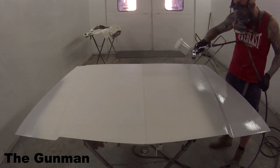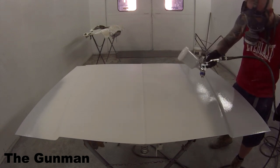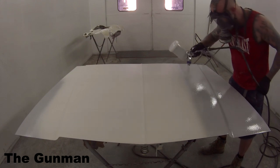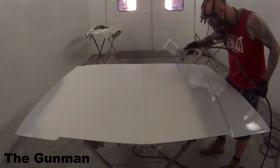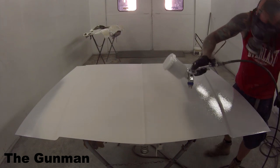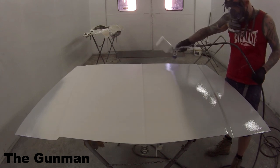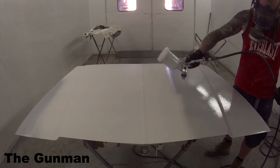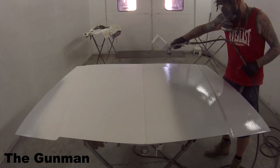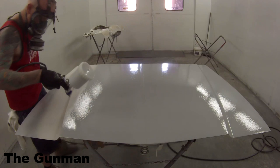The hood's actually still not finished — I'm just editing this footage up as I go. Unfortunately I can't give you guys an ending on this car yet. Usually I like to include the finished product at the end of each video, but for this one I'll have to leave it as is. Back to the gun itself — great gun for the price, totally an absolute winner. I think these Star guns are starting to get a little bit better. I've got a little Star mini gun too and I'm really happy with the results. It seems like nice quality and gets the paint on real nice. If you need a polyester gun, don't go past the S106 Star spray gun with a 2.8mm tip.